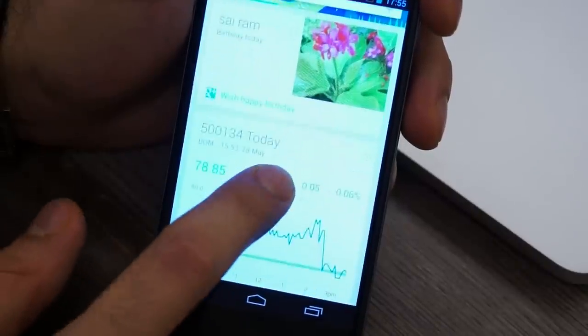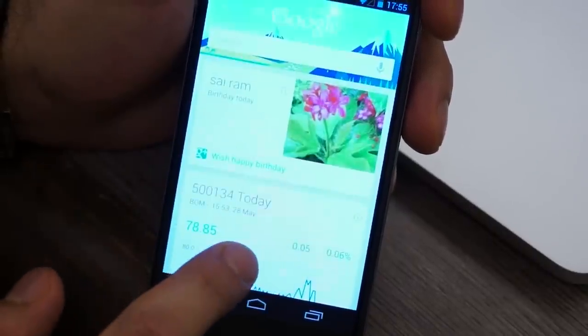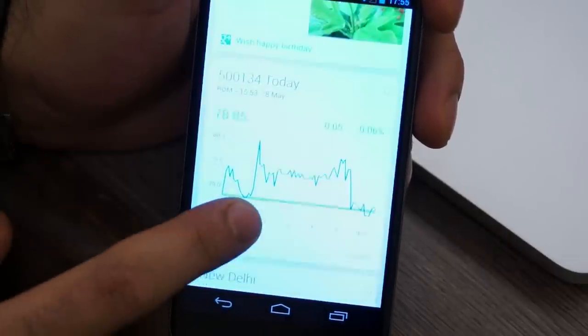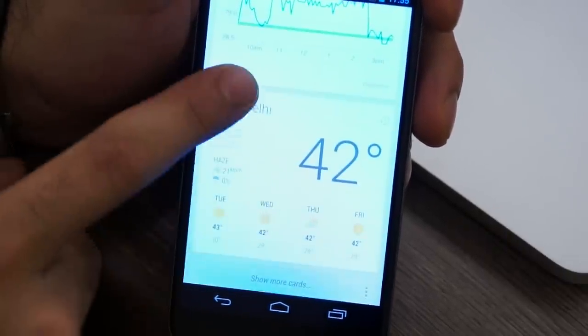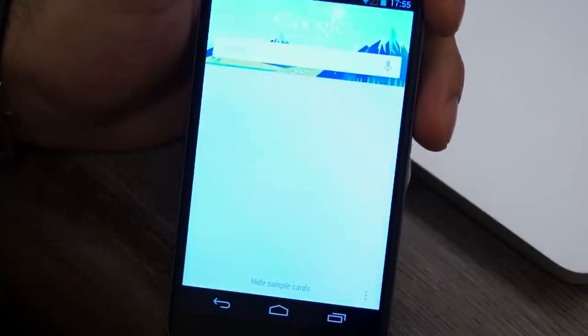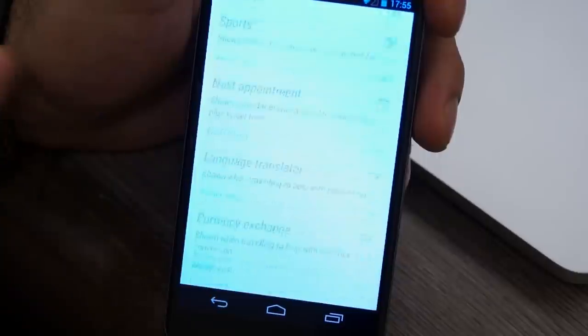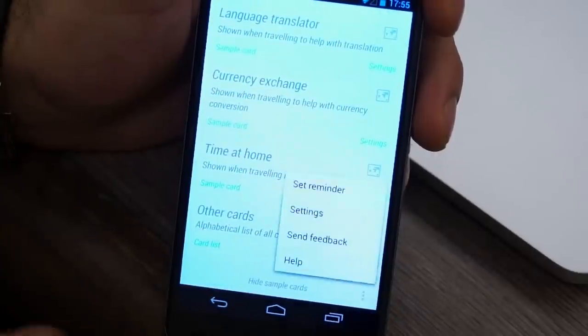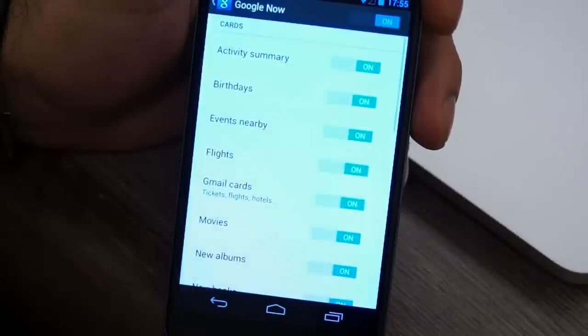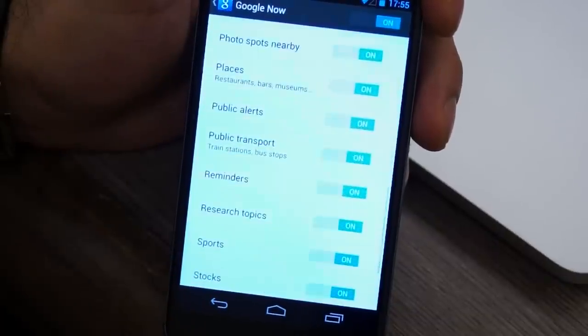You can also overclock the device to run up to 1.9 gigahertz now. So that is something that you might want to look at. But the Nexus 4 itself is pretty difficult to control in terms of heat. So why would you want to take it up to 1.9 gigahertz? That might actually blow out the glass on the back. So if you want to hold on to the device, I say that you underclock it, bring it down to about 1.2 gigahertz or even 1 gigahertz, and then undervolt it so that it saves up your battery life and it does not heat up the device.